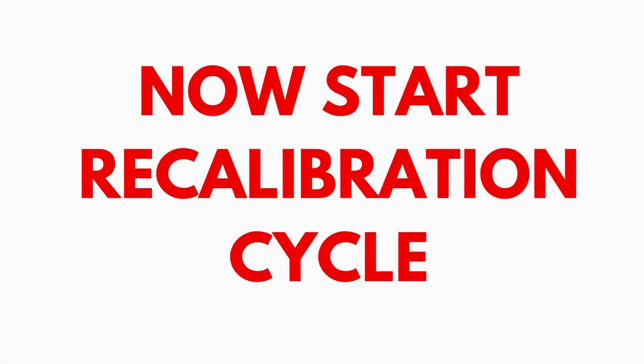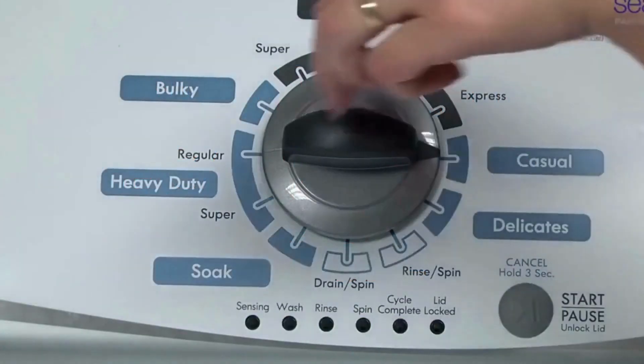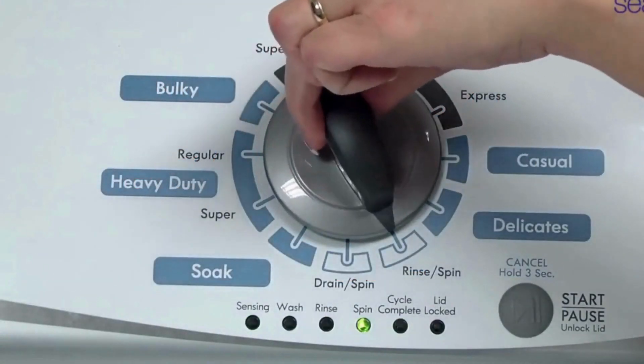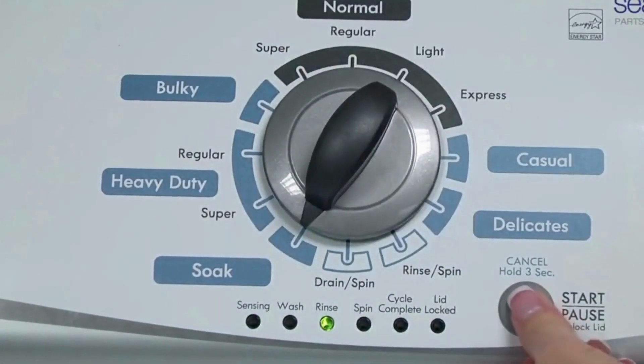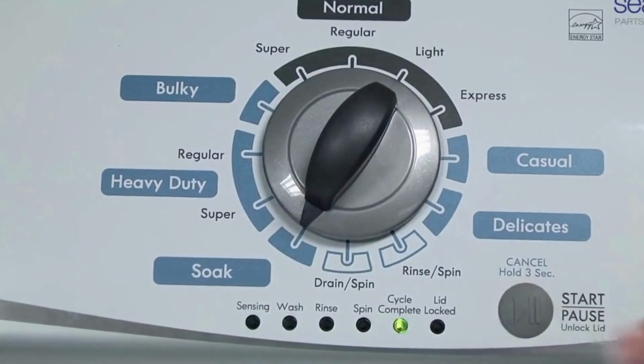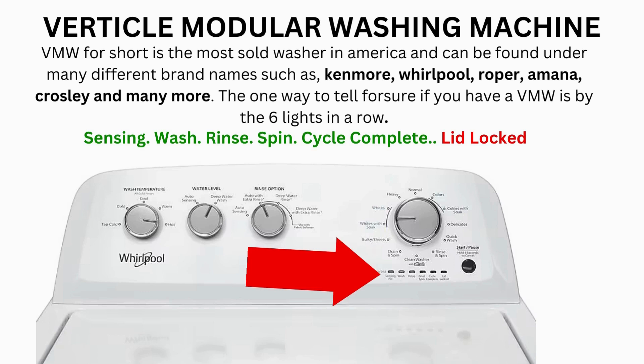In the diagnostic mode, with all lights flashing, select the calibration cycle by turning the control dial 4 clicks clockwise, or 4 clicks right. When you're on the correct setting, the rinse light turns on — then simply press start. The calibration cycle begins and runs for 2-3 minutes as it checks all the cycles and functions on your machine. When the calibration cycle ends, if all goes well, the lid unlocks and the washer shuts off.